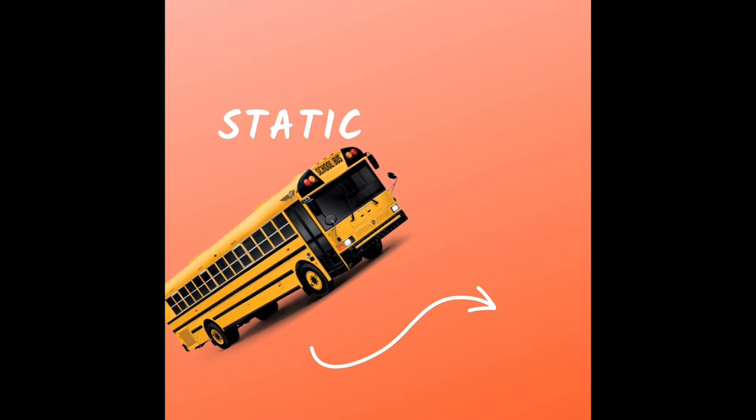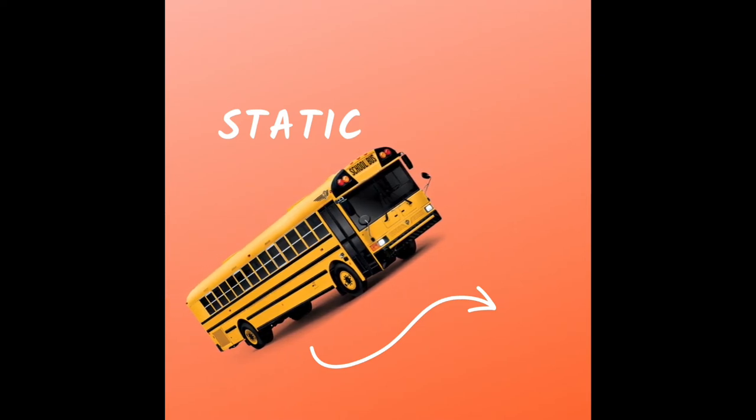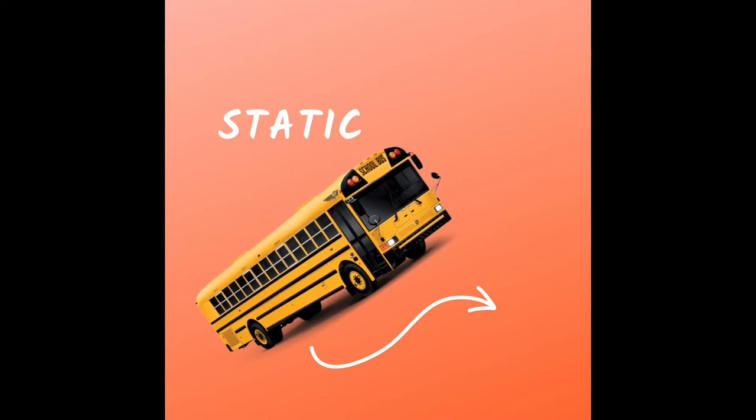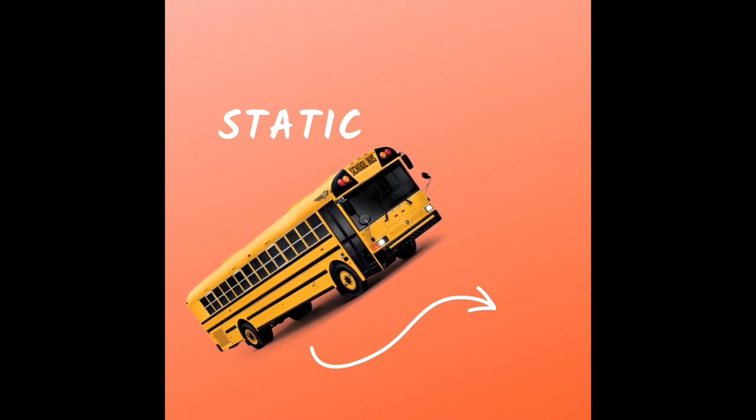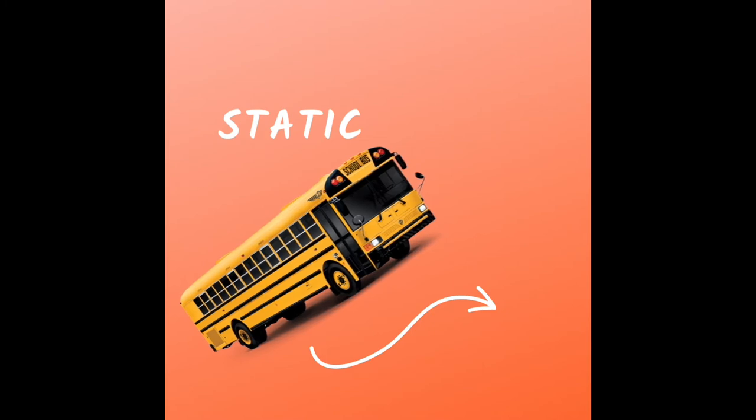Static test. The bus should be turned off at this point. Nothing applied, nothing on. Watch your gauges for one minute, and there should be an air loss of no more than 2 psi in one minute.